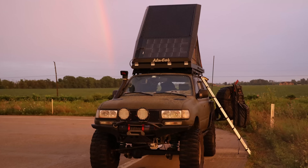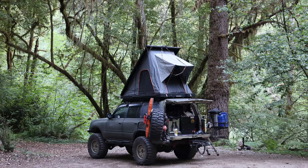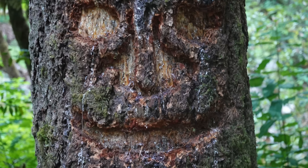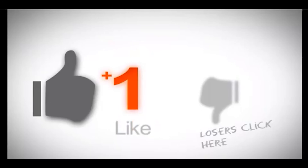So there you go — I hope that helped out. I couldn't find a video showing me how to simply do that. They were all showing me to use a pigtail and wire it together. I took the battery under my truck, I did the top two left pins, looking at the female socket exactly as the diagram shows, and you're good to go. If you enjoyed this video, hit that like, share, and subscribe. Leave a comment below and I'll try to return the favor. I am out.